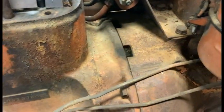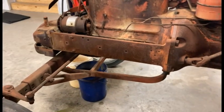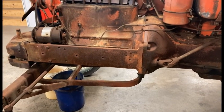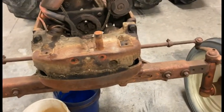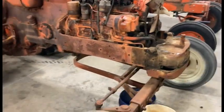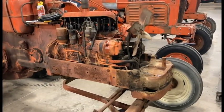I've got a little pry cavity right here where I can stick my pry bar in — it shouldn't need much prying because it should just slide right out and I can roll it straight out forward. I'll have to get the nose cone out of the way, but you can roll it forward and that gives me access to just the engine. The front bolster keeps everything stable up front, so I might study that a minute and change my game plan slightly. Either way, I need to block up that back half first, then we'll figure out next steps.